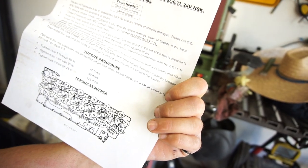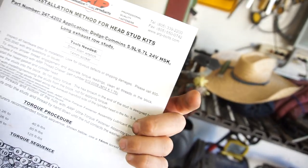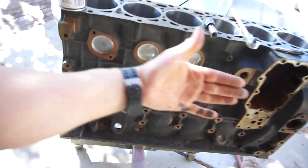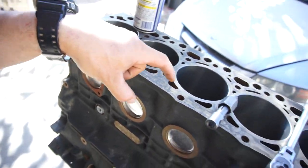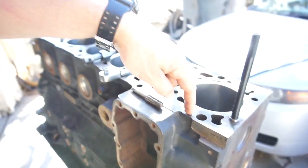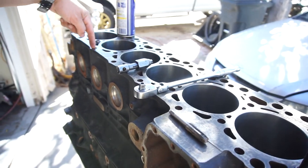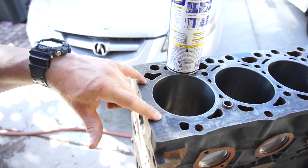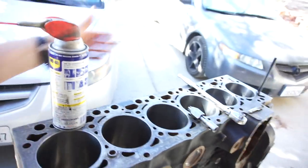The 6-7-24 valve long exhaust row studs — those long ones go on the exhaust side of the head. This is the exhaust side, so all six long studs go here: 1-2-3-4-5-6. That sounds about right. Then the short ones will go all the way down on the intake side. I'm going to get all this done, flip it over, and do the other side.